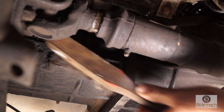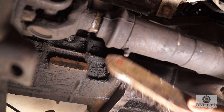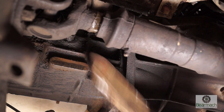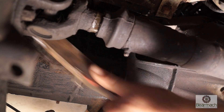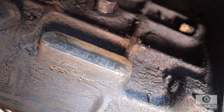For the main gearbox, you'll again need a wire brush to clean off the grime and rust so you can read the number. This kind of number recovery makes it easier to order parts and identify the components you have. Here you have '56A' and a 'J' suffix, which identifies this as an R380 gearbox.